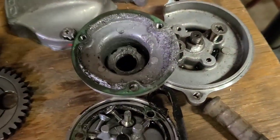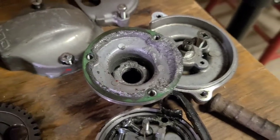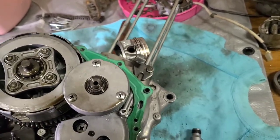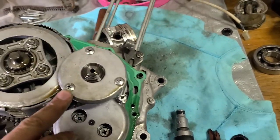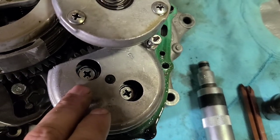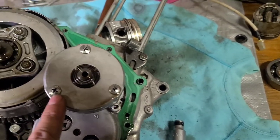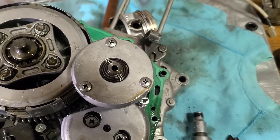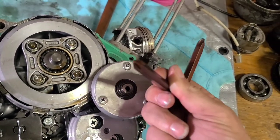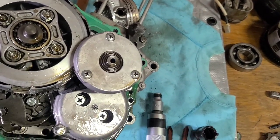The lock nut — you can see, this is an oil filter that I pulled off another engine. As you can see down in there, there's a lock nut. And there's also a lock nut holding on the clutch basket, the same size. You'll need an impact screwdriver for these Phillips head screws here — these three — and those two down there holding on the oil pump. Now, they're actually not Phillips head screws. They are Japanese industrial standard screws, a little bit of a different type than Phillips head. I don't have any, so I'm just using Phillips head, which will work on this.